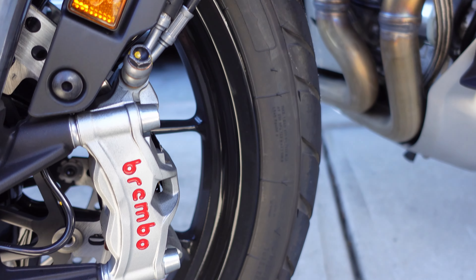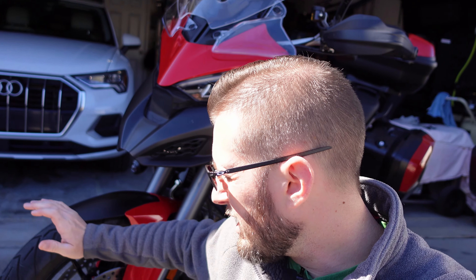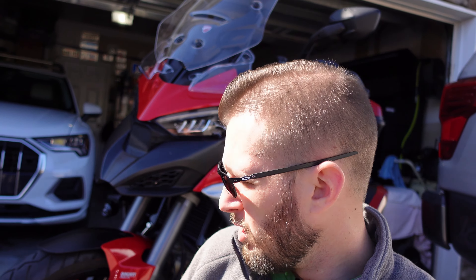It's not quite as sharp as the old 1200 Multistrada. The bike wears the same 120/70 Z-rated tire on a 19-inch instead of 17-inch, so overall grip and road profile are about the same. A concern I mentioned was less sticky rubber available for the 19-inch front. I kept the Scorpion Trail 2s on my 2015 Multistrada the whole time — I'm very impressed with them. They handle temperature ranges, rain, and dry conditions very well. With the 19-inch front, I have no concerns.